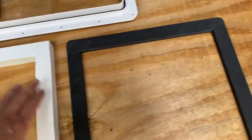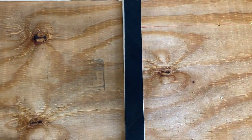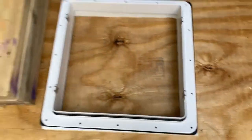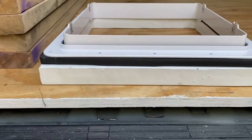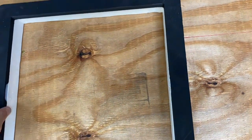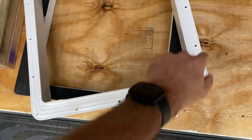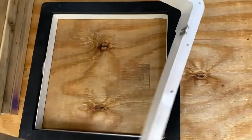And so this is going underneath. Then there's the van skin. This goes on the top. And then the flange for the van goes like that. So you'll have kind of a separation. We'll do Sikaflex 252 to the top of the van. We'll use Sikaflex to put this down on the van skin itself. And then on the bottom of this, we'll use butyl tape to go around here, and then that will sandwich down.